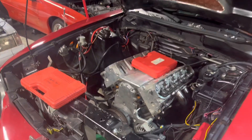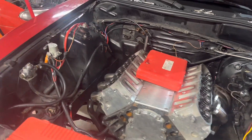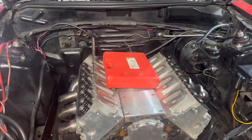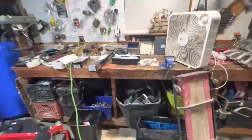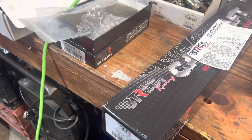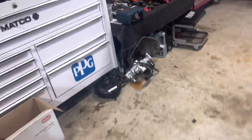What up YouTube, back at it again — we are pulling apart the Mustang's motor. I broke four valve springs, so I ordered the BTR Stage 4 kit. He had a Stage 4 kit, so I got the pushrods, new valve springs, and the new cam.